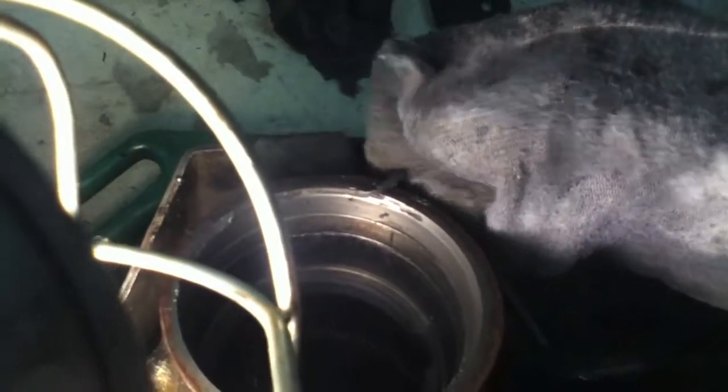Something I wanted to show here, as I'm cleaning up this housing on the pinion side - you can see some silicone buildup right here that was on there from when it was all installed. You want to make sure you get all this off, nice and clean, so that you're starting fresh when you pound in your new seal. You don't want any of these little bumps still here to prevent it from sealing, or you'll get a pinion leak out the front.